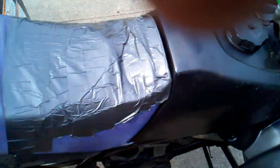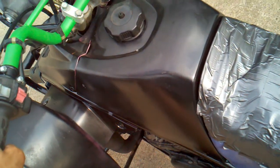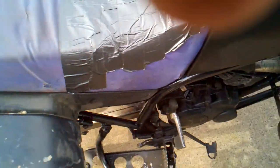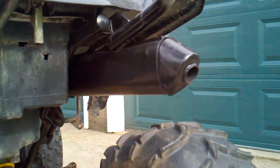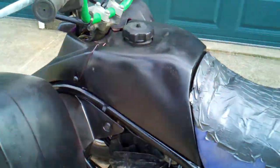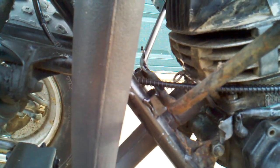That's in gear — nope, it's not in gear. There we go. All right, so I'll start it up for you guys. It's pretty loud. It leaks a little up in there because there's no spring holding the exhaust under the flange.